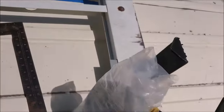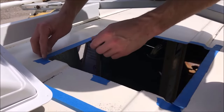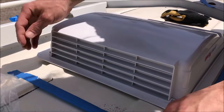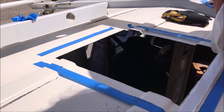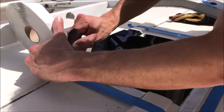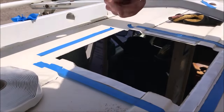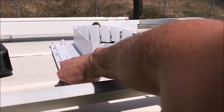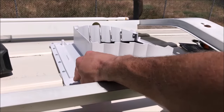Let's clean up the edges. Just line the tape around the outside — that'll give us an approximate limit. A little knife or blade is convenient to have just to cut it, and we'll go ahead and lay it all the way around. We're all screwed down. I got them nice and snug — it kind of wants to warp the flange, so I was careful not to tighten one at a time. I tightened them all a little bit at a time all the way around, trying to keep it even.